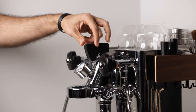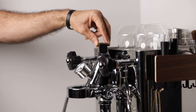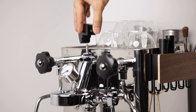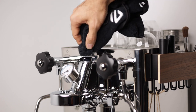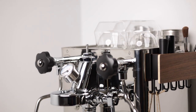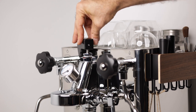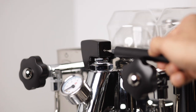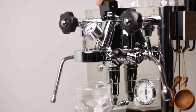Depending on the recipe you normally use, you can calibrate the needle valve on Bianca to change the range of your water debit. For instance, mine is from 0 milliliters per second at 11 o'clock to 6.5 milliliters per second at 2 o'clock. In order to do this, simply unscrew the screw at the top of the paddle at 11 o'clock and take the paddle off. Now you can freely rotate the needle more than what the paddle allowed you to, so you can set it so that it's completely closed at 11 o'clock — which will give you a certain max water debit — or you could unscrew it and have a different starting or minimum water debit, which will give you a higher max water debit too. After you set the right minimum water debit, put the paddle back on, make sure it's at the leftmost position, put your screw back on and tighten it. Then measure your water debit with either method we discussed earlier in the video to make sure everything is set.